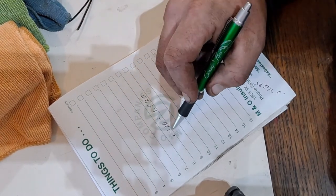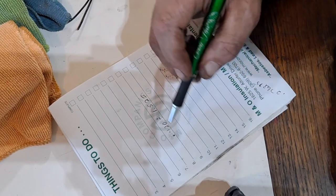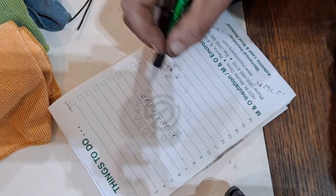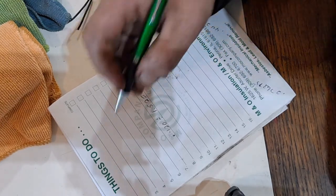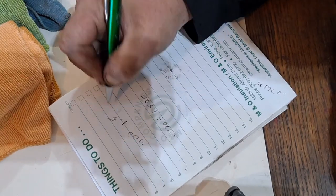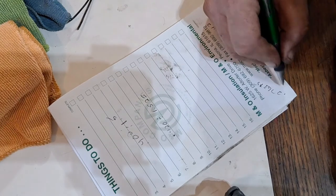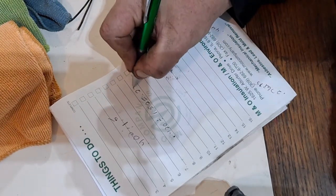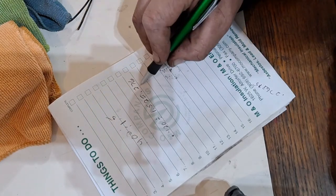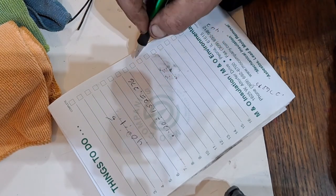So, you'll take the amount of lift the cam is advertised lift. Let's say the Vortec 0.420, you'll divide that by your rocker arm. So if you do have a rocker arm, say it's a 1.5, you'll divide that. But this is what we got on the Vortec. Right here is what I come up with. Let's just go with the 0.276. So you have 0.276 with 1.5 rockers.